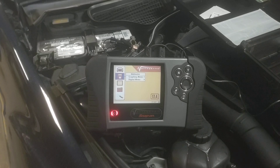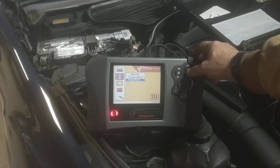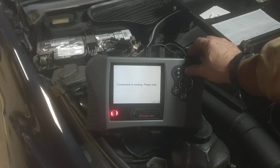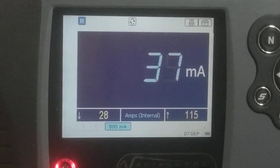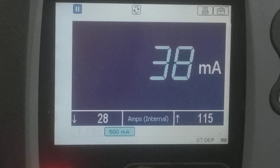I've got the battery disconnected and we're going to be using this meter to diagnose the vehicle. It's a digital meter measuring amps internally — it can measure shunt amps without a low amp probe. The draw is showing 35–40 milliamps. I'll zoom in so we can get a better look. The spec on this car is under 85 milliamps, and this thing is way under that number.